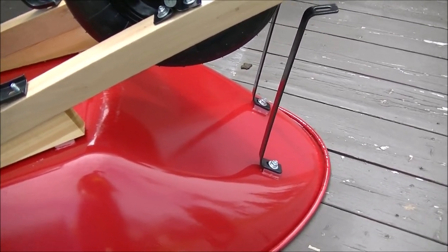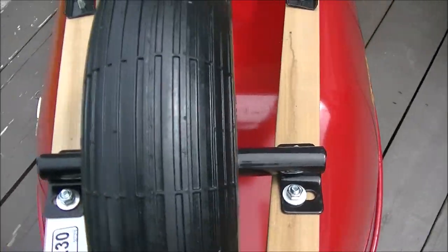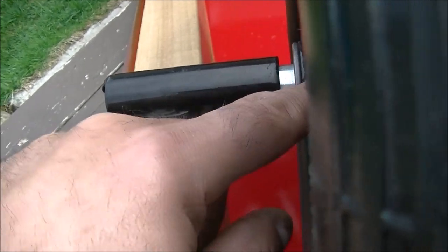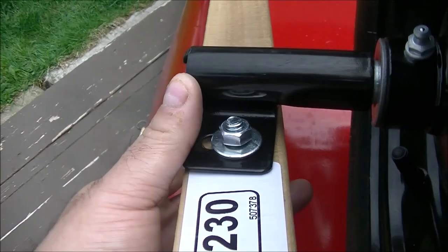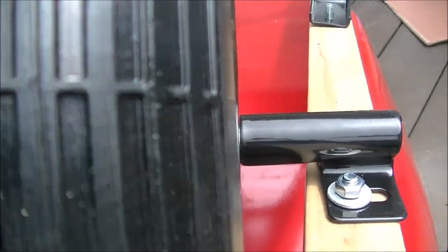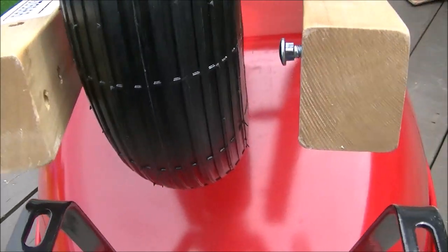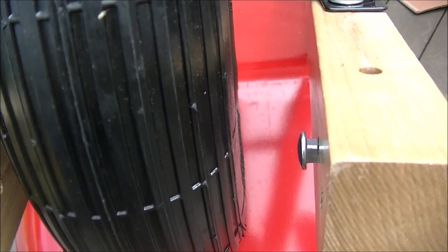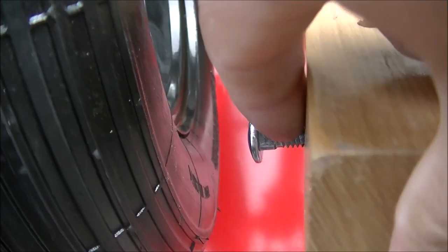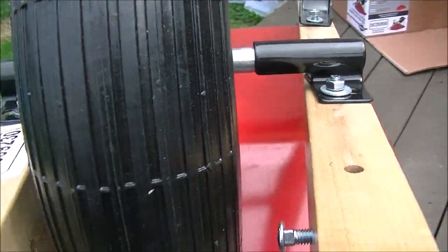I have those front brackets set in place, but I'm going to wait until further in the project to get that assembled properly. So I have the tire — as I mentioned, the silver shaft went through the tire. And of course this side plate, this bracket, bolts with two bolts here on this side and that bolt on that side as well. Once everything comes together, this is the final touch-up to line up your tire so you have the proper spacings. So you don't get chafing. The instructions really come in handy when it says to leave everything loose. If I had the tire fully assembled, I would not have been able to move this around to get this bolt in place for this front bracket. That's why you leave everything loosey goosey.